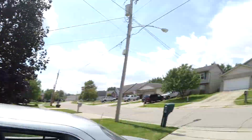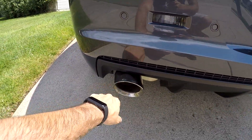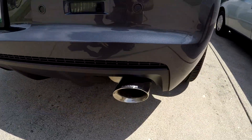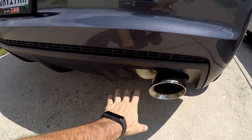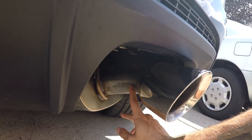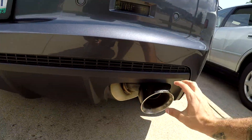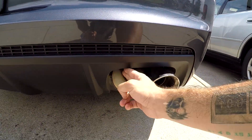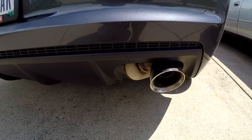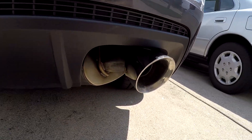Let me show you what I was talking about with the tips. This is Corsa's setup — it's all smudged and dirty, but look at this side. As you can see, this is the 1LE rear valence. When I had quad tips it was able to accommodate that. But the way this is bent, the part where you'd weld the tips on starts right about here — and look how far over that is. It's clearly farther over to the right on one side and farther left on the other, so the second tip of the quad would come in the wrong place and hit the diffuser. The mechanic said there's no way that was going to work.